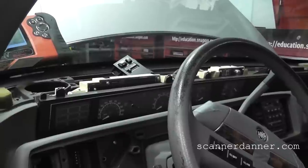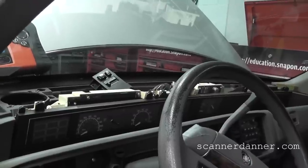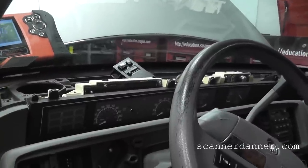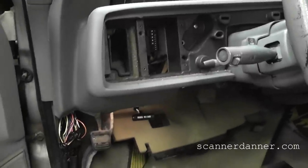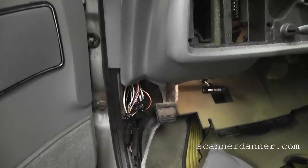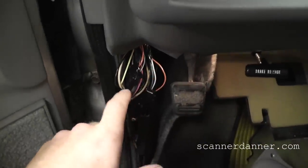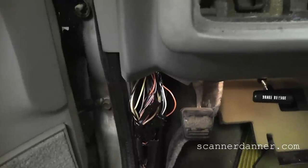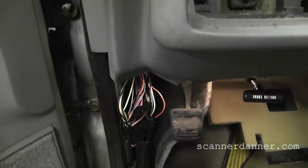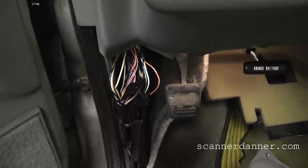Quick shot of the dash — we took the top panel off to access the cluster and look for that lamp control module. We're in desperation mode. All we have is a sound and we know things are going on and off inside the doors. Our thought was to use our inductive amp clamp and start measuring current flow on the wires going into the door. Our focus was on the orange wire, because that's the color going to our diagram on the ELEC fuse. We checked all the orange wires in the door and found no current flow whatsoever.